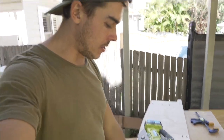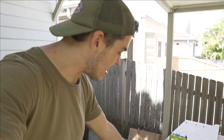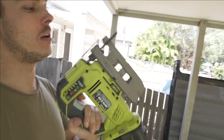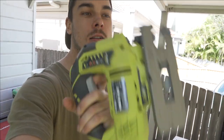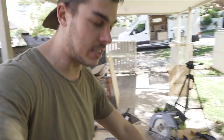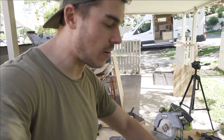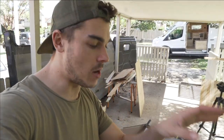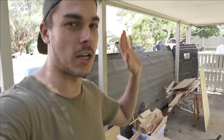I've cut out my template, so now I need to cut the angle. I've changed the angle on my jigsaw, so when I cut now it's going to cut an angle but I'll still have the same side on the facing side — and there will be just a 45-degree angle cut into it. That way when I push it up against the van, the walls and contours won't stop it from being flush anymore.